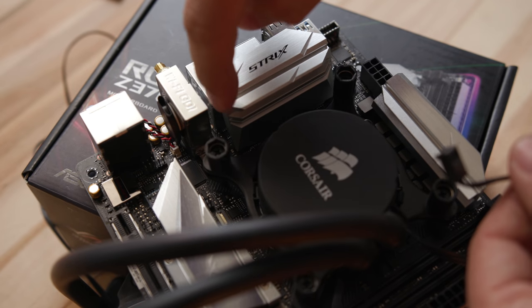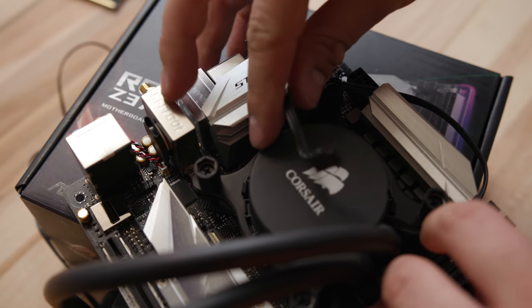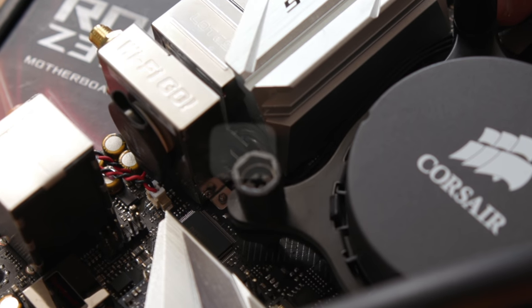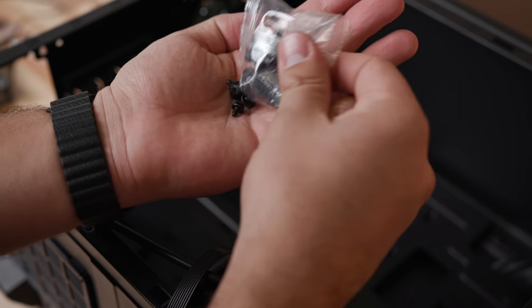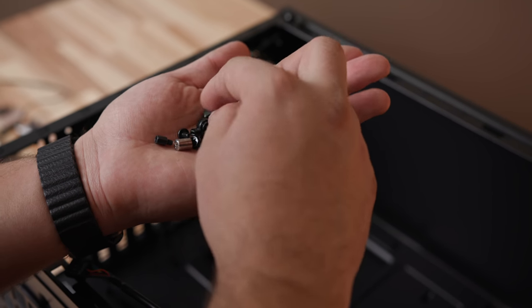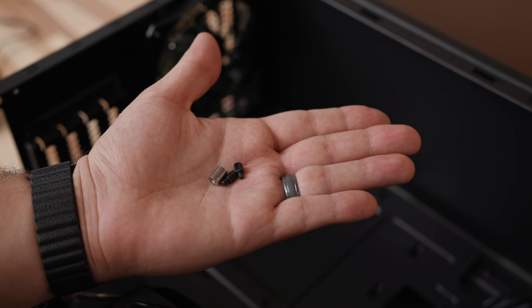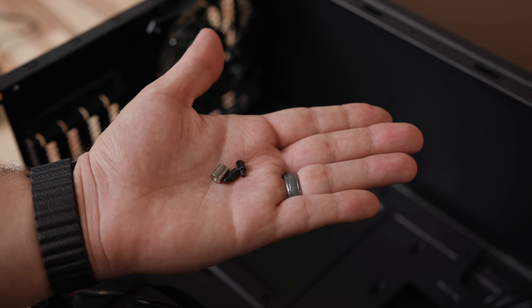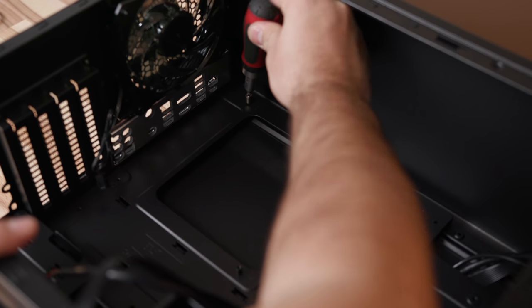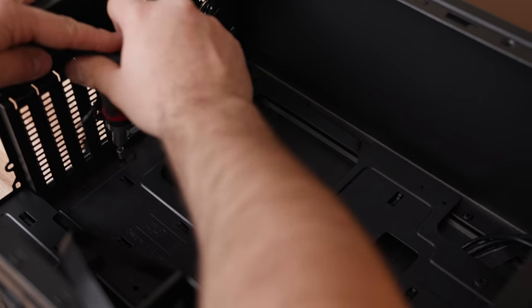Align the water block and then carefully and slowly tighten all the screws on each end. Don't tighten one down all the way — get it about a third and then move on, rotating around so you're putting pressure evenly onto the CPU. Now let's attach the three-pin cable to the motherboard — this is what powers the pump built into the all-in-one water cooling kit. Since these cases are universal, we need to install a couple of extra standoffs to support the motherboard. For this specific motherboard, we need to install one at the top left-hand corner and the second one right below it next to the PCI slots.